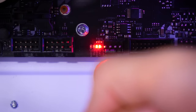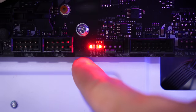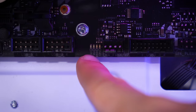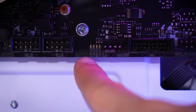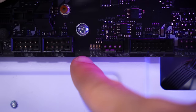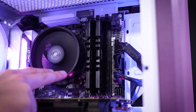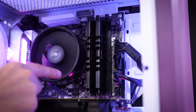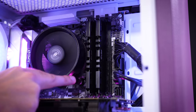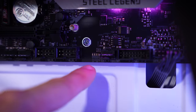I also noticed there's a set of debug LEDs at the bottom of this board. Two are lit for CPU and DRAM, usually the first two checks in a POST process. Occasionally these lights flicker over to the boot light and the VGA light — the blinking is very odd, usually it's one after another, but here it's a random sequence. All turn off after a while, still no signal. Also noticed the DDR4 is in the wrong two starting slots — it should be slots two and four going left to right for dual channel with only two DIMMs. This normally wouldn't prevent the system from posting, but I'm going to change it anyway since we're having issues. Still no POST though.